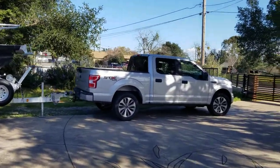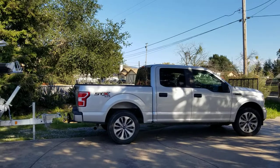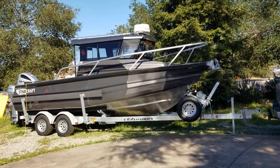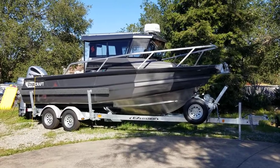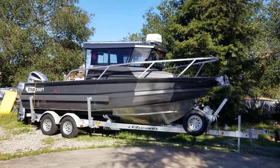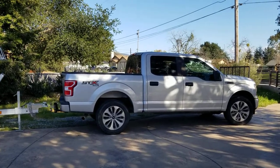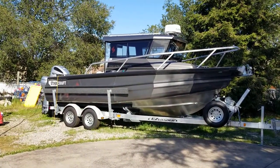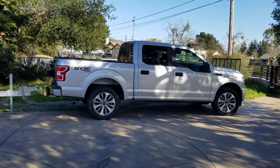I'm using a 2018 F-150 V6 with a 9,000-pound tow rating. The boat probably weighs close to 5,000 pounds and with the trailer it's probably pushing 7,000 — so using the 20% rule, I'm right at the max for this truck. I'd probably be more comfortable with a 250, but given how I travel and that it's mostly flat, I think this truck will do fine.